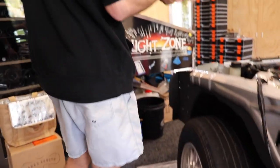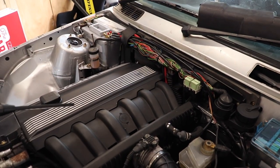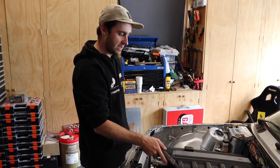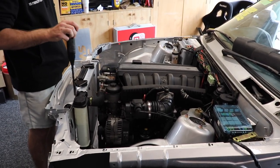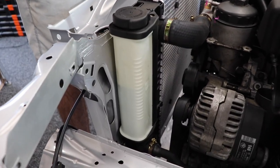Jumping into the engine bay, I found that the vacuum hose that goes to the fuel pressure reg on the rail had popped off — so that was our vacuum leak. Connected that again. Got the missing hose clamp for the MAF, so that's back on. Ran it up for a while and got the coolant sitting at the right level, just topped that up.